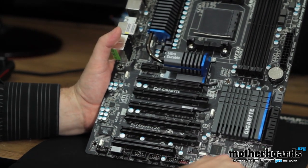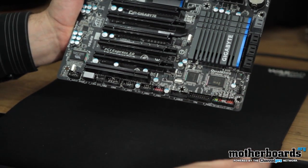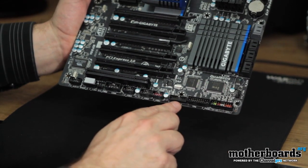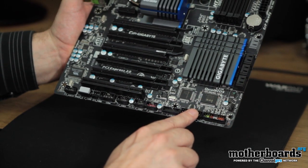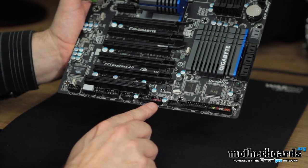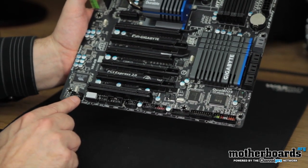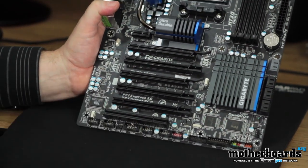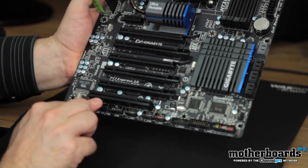So here we go. Here's all the stuff where you connect the motherboard. You can see it's all color coded and everything, so it's easy to take all the wires from your case and connect them here, such as your start, restart, all that kind of stuff. We have a breakout box right here for USB 3.0. Then we have a TPM breakout panel here as well. Then we have USB 3, COM port, another USB port, another USB port, all these for additional USB ports, breakout box if you want to use them. You also have an audio and an additional 1394 FireWire port. That's here as well. I'll go to remove that little plug right there. Most people never touch these ports. These are usually overkill, but some people might.